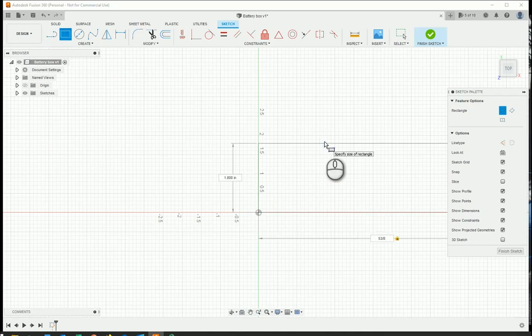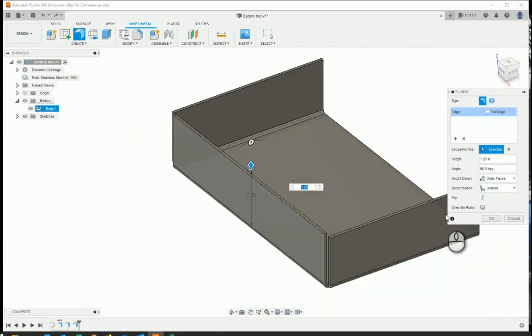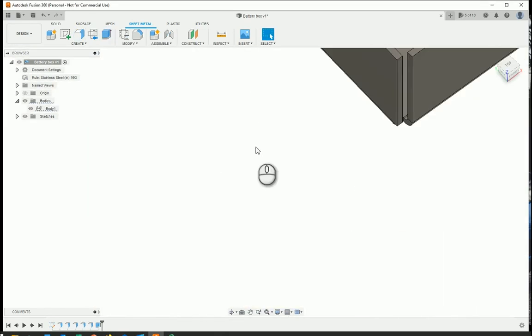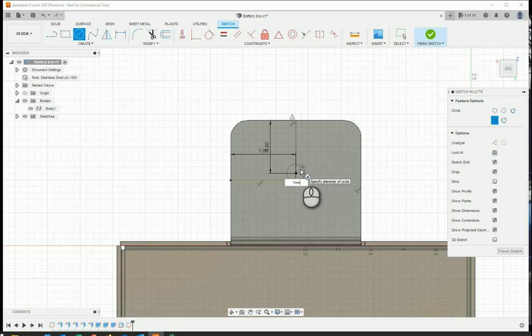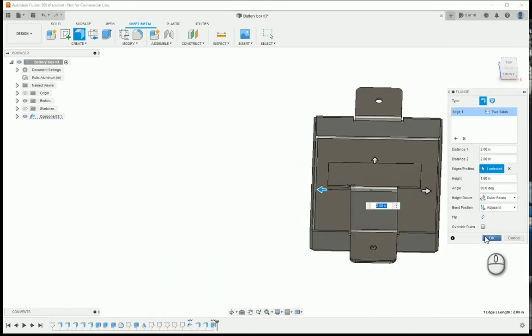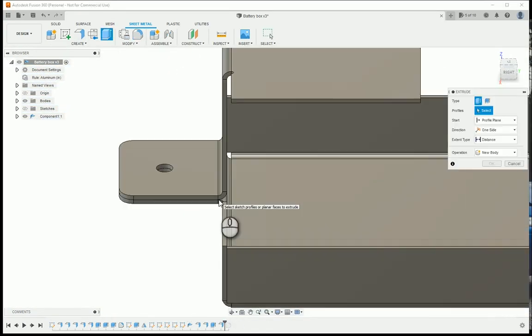I already have a rough idea of how I want to build the mount, but we're going to hop into Fusion and I'm going to draw it up. I'm going to be keeping the design relatively simple. It's going to be 2 different pieces, like a battery tray and then 1 piece on top. And then I am going to make some 1-inch tube nuts out of 1-inch outer diameter tubing, and those are going to be welded to the chassis, mounting the whole thing in. I wanted to do it that way just in case, for whatever reason, I need to change the battery in a year or two, like this battery doesn't last, or I just hate it. I can just make a new battery tray essentially and throw it in the car. It should make it relatively easy because I can just reuse the mounting points that I already have in the chassis.